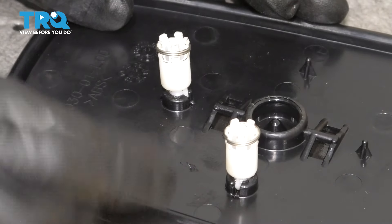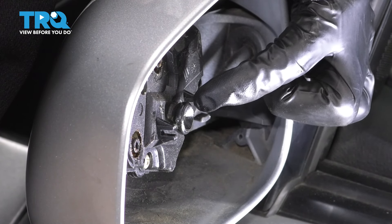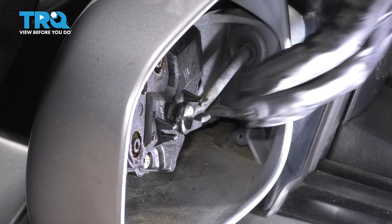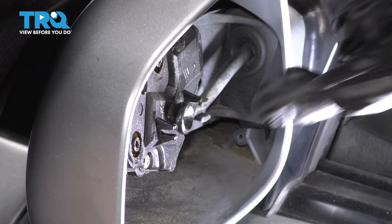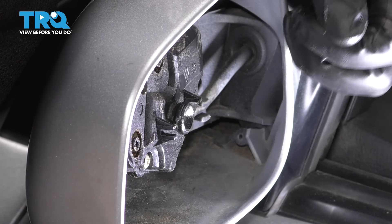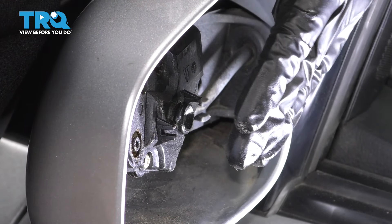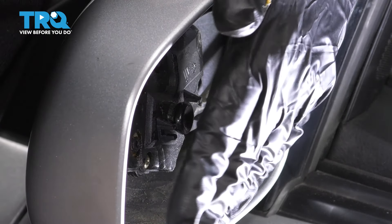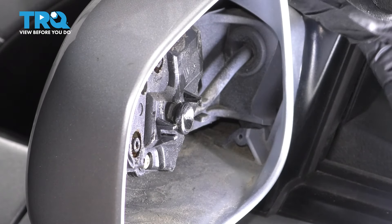I did this to both, so this is ready to install. Looking at the motor for this mirror, this is the center pivot point — the mirror needs to line up with this and snap into place. These two right here are the two motors that actually move the mirror back and forth. These just turn and the tabs that we pressed in have threads, so it either threads in or out on the side or at the top to adjust it.